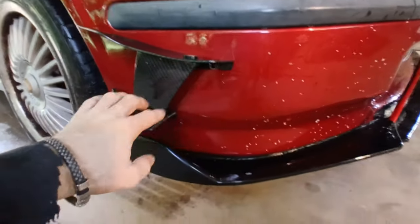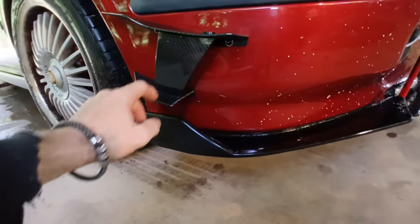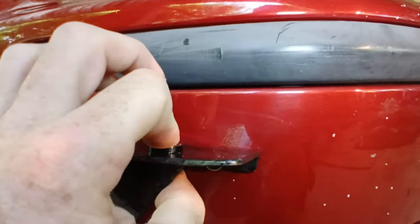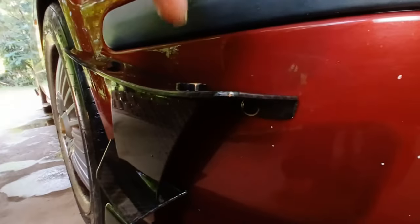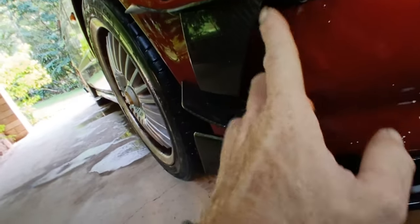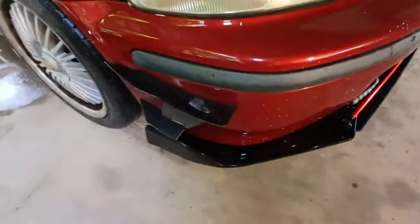So anyway, the way these are mounted, the bridge, I'm guessing you could call that, from the top part to the bottom part, was not going to sit flush properly, as you could probably see up in there. So I drilled through where it was going to sit, marked up where it was best suited, drilled through this one first, marked, and then drilled through the top from the bottom side to get the right position. That's just a bit of extra support so things aren't likely to fall apart as easily.